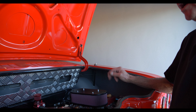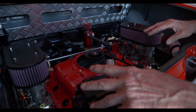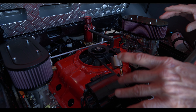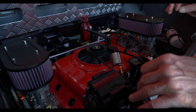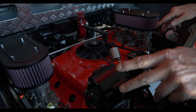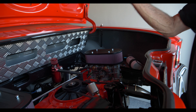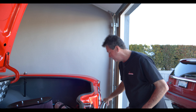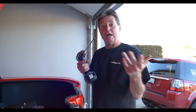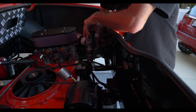With the fuel system sorted, we turned to the oiling system. I added eight quarts of oil and the PTF additive, which is a zinc product to help break in the motor. With Caleb's help, we turned the key on. As I'm turning the engine — this is what you call pre-oiling. It's just a piece of steel that fits right inside my distributor.